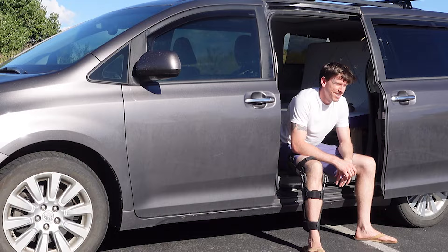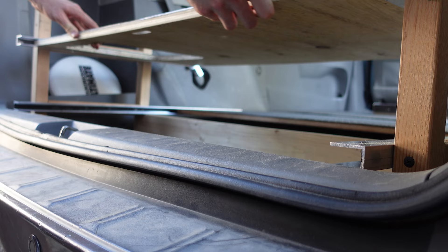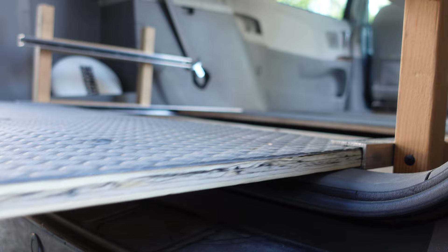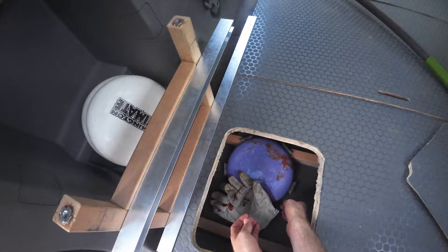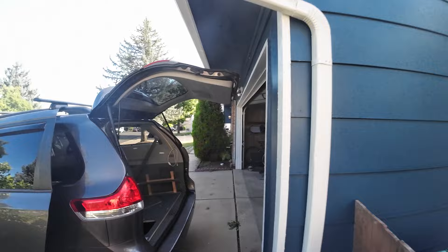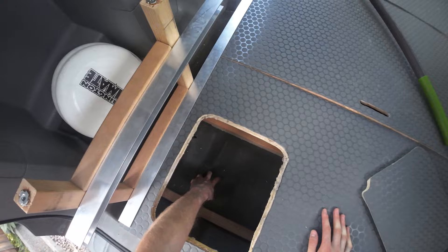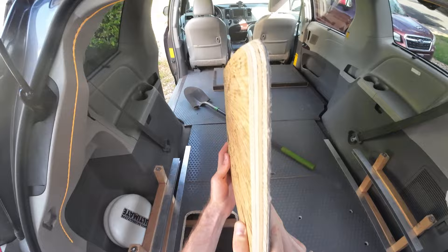What makes this design more flexible than a Chinese gymnast is its ability to convert to a cargo van. After pushing the bottom panel along the track all the way to the back, I can slide out the kitchen shelf and slide it down into place. Then I fill in the plug for the sink spot. That hatch can be used to access the lower compartment, and it's very strong because I cut it at an angle and filled the gaps with hot glue so it laid flush.